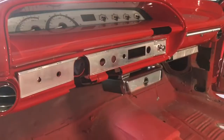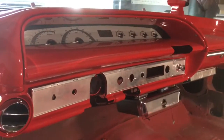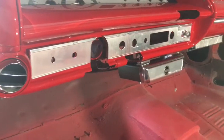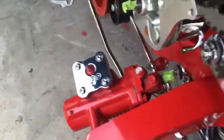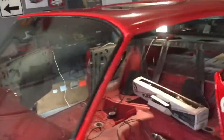Next, I'm going to be working on installing the Ididit tilt column. I got a paintable steel Ididit, and I have all the parts to install it. So what I'm going to do is lay all the parts out, show y'all all the part numbers and everything you need to get it installed. That is going to mate to a CPP 500 gearbox, so all that's going to mate together, and I'll show y'all how all that goes. It has a D shaft that runs in through here, and then right here you just put your boot. But I'll explain that all in the next video. I'm going to get everything out of the boxes and lay it out, and show y'all the installation on it. It's pretty straightforward.